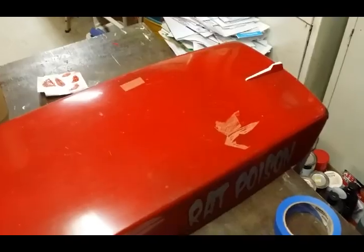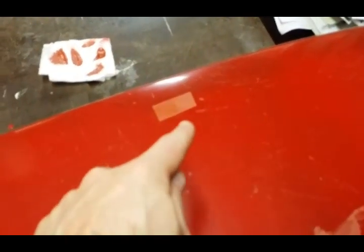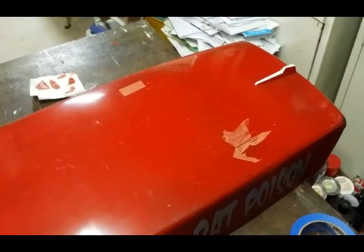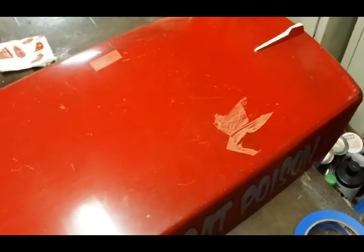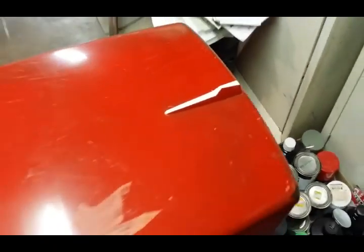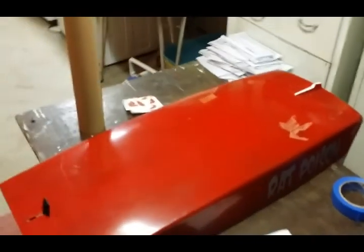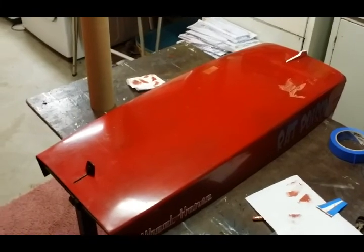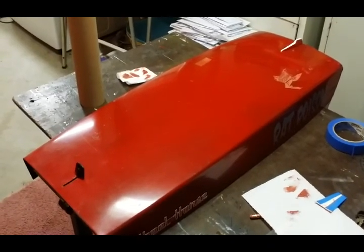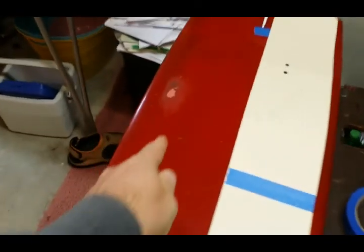With a little bit of masking tape I've masked around the dent and a couple of deep scratches, and lightly put some spot putty in there. I'll let it dry overnight and then tomorrow I'll sand it down to get everything nice and smooth. The dent should be pretty much gone. I'm not filling in any factory spot weld marks — I just don't want to see a big imperfection once I lay the color down.